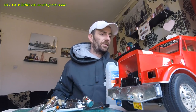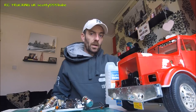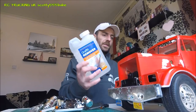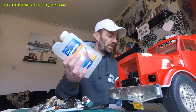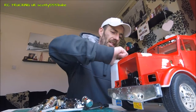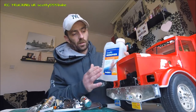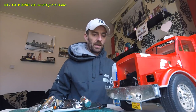I have used paint strippers in the past — they come in a plastic tub, they stripped the paint fine, but then they left the plastic soft. It was a Scania I did in the past; when I came to strip the paint on the arches, on the black parts, it melted them. But I've never ever failed or gone wrong with this graffiti remover. It's called Desolvit. You might be able to find some on eBay — they used to stock it in Screwfix but they no longer do. With a little Google search you might be able to find this product or something with a similar solution.